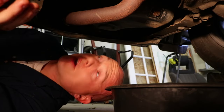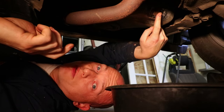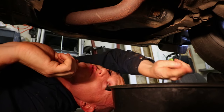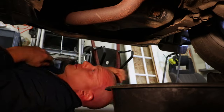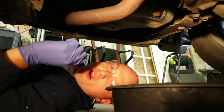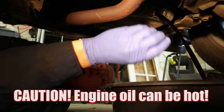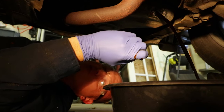We're under the car here. We're going to drain the oil out of the crankcase now. Right here — this is a 14mm bolt. We're going to grab our 3/8 ratchet, 14mm socket, spin this off, and make sure we direct it into the drain pan. Eyeglasses and gloves first. It doesn't take much to break it free, then you're just going to spin it out. That oil is pretty dirty — not the dirtiest I've ever seen, but it's pretty dirty.